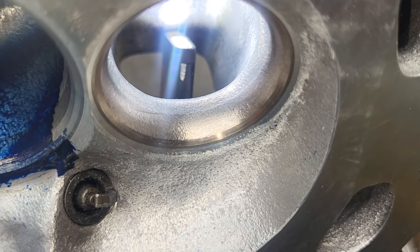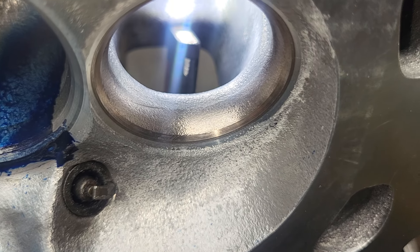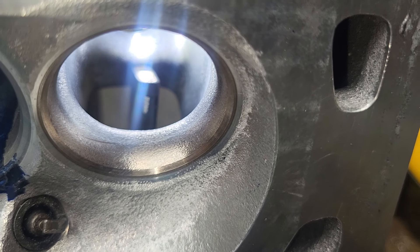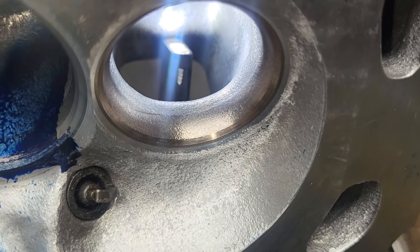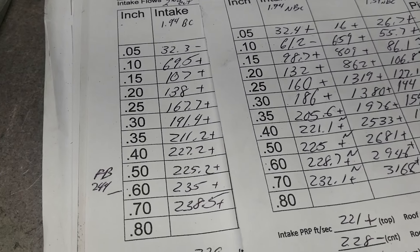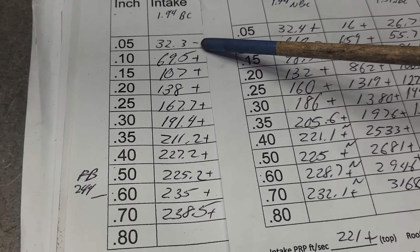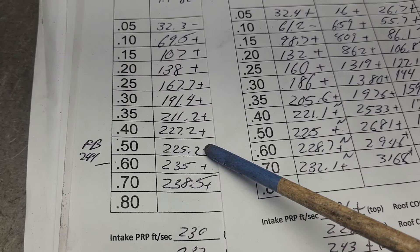The exhaust short side got a little bit of work. The first cut is going to be quite high and then I work down to get my air speeds where I want them. It was not a complete win — we'll go over the pluses and minuses. The bowl itself hasn't been touched since the first cut, so all I did was work on that short side. On the bench I was really expecting it to pick up more than it did, but on the second cut we got all pluses all the way down — some of them extremely small, like 225 to 225.2.